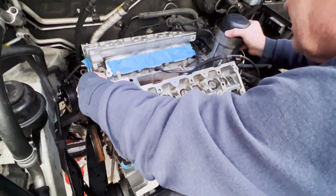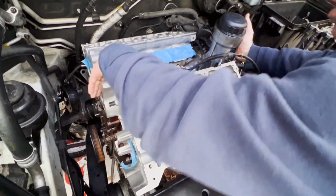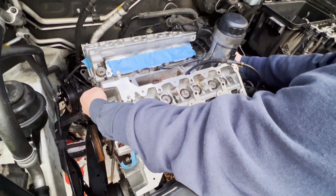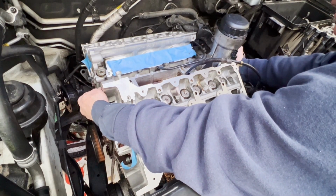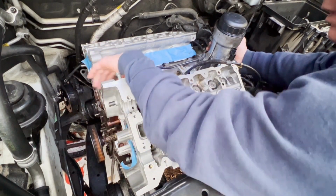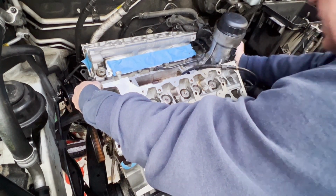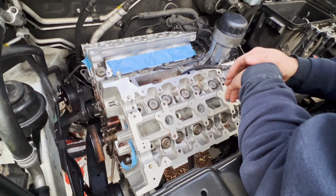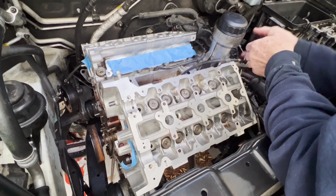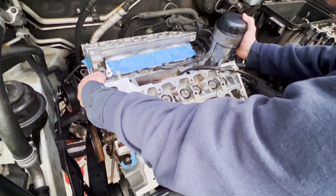Well, there is a pretty good chance that the gaskets, there is a locating pin, but these gaskets are up underneath. You can't see them. When you go to slide this in, there's a good chance they could slide out of place, even fall off, and you never even know it. I mean, this one might even fall off down into this cavity down here where the knock sensors are, and you'd never know it. And realistically, you'd probably have to take the air box out to have enough space to come in low enough to slide this in.